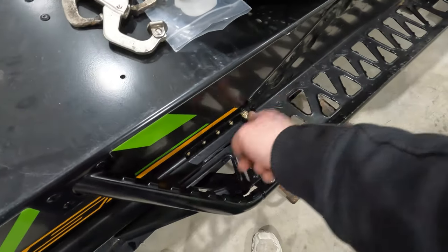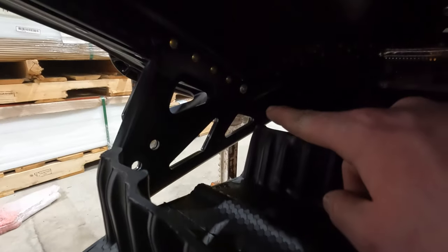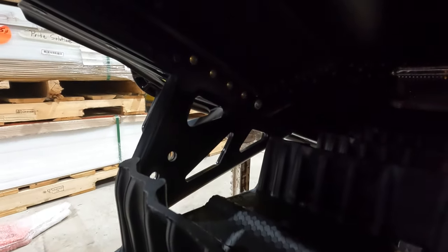One thing to note: you will need to take out this nut and bolt on the inside. I don't know if you can see it up in this corner — it is an Allen or hex head. All the rest are rivets. Make sure you've got small left-hand drill bits so that you just don't spin the head around; you can drill out the core.